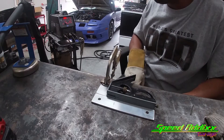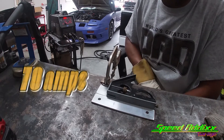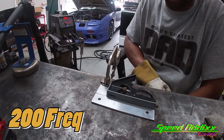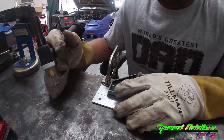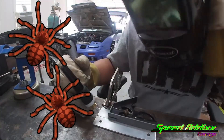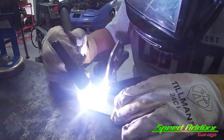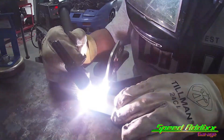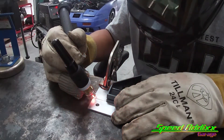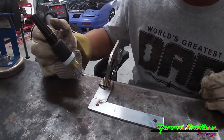We're gonna start with AC settings, about 78 amps. For the frequency, I'm gonna do kind of in between - we'll do about 200. Let's see if I can get a tack with no filler and see what I can do. Yep, it worked.